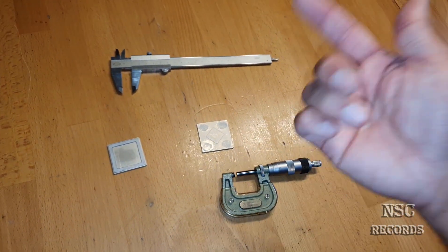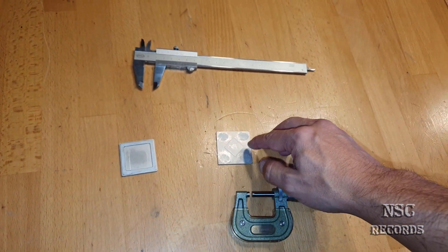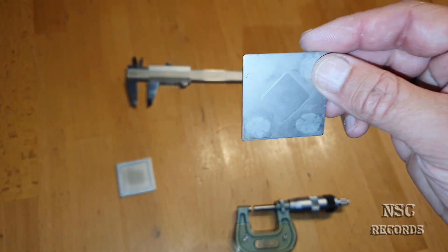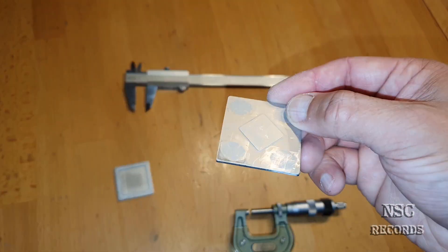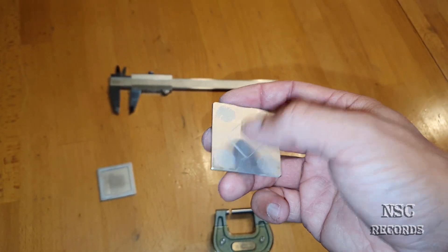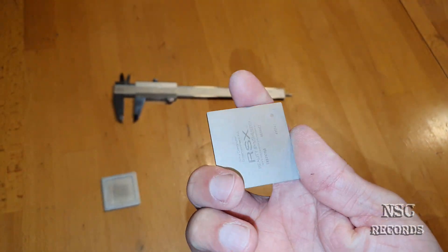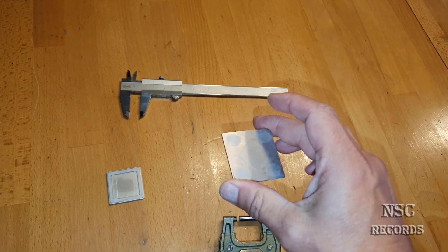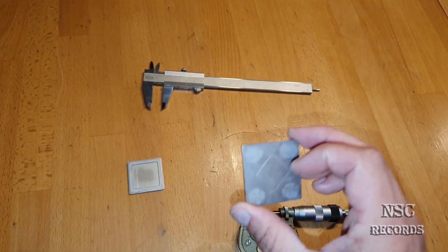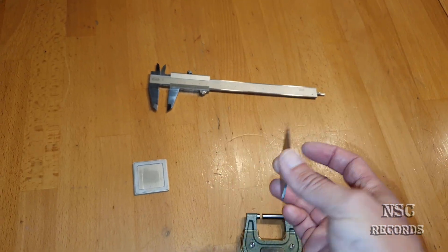It's all about testing, testing, testing. I'm going to cut all this heat spreader - I'm just going to leave the square in the middle, because this is the most important part for contact to the chip or to the cooler itself. The RSX sits here with thermal paste, then heat transfers down again with thermal paste to the cooler. Heat spreaders - we all know this is the biggest scam. It's always better when the chip gets direct cooling.